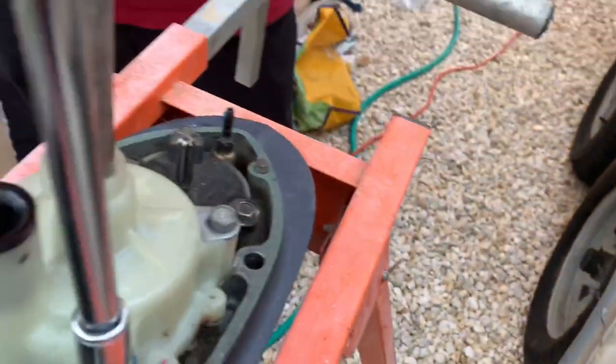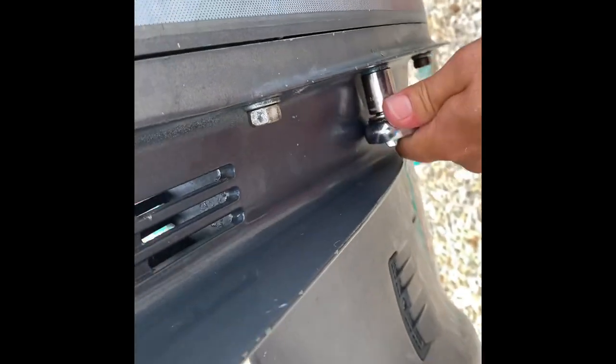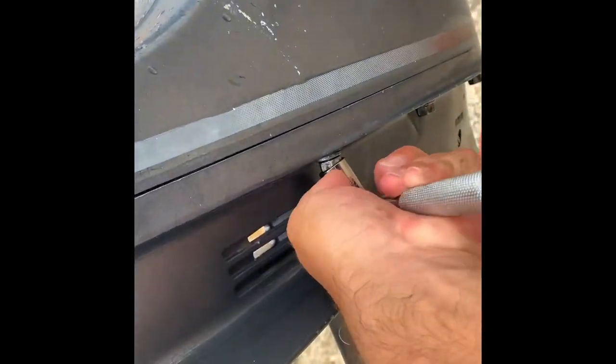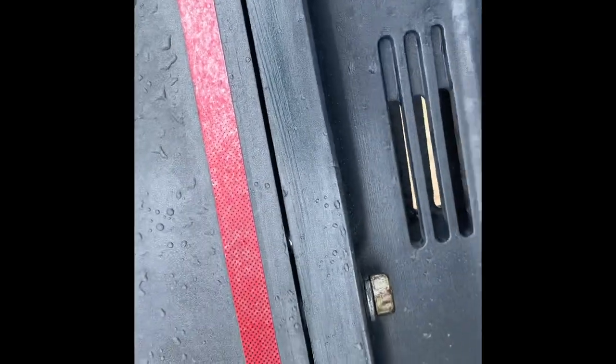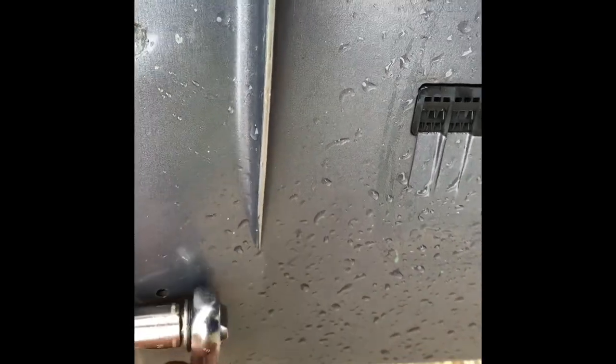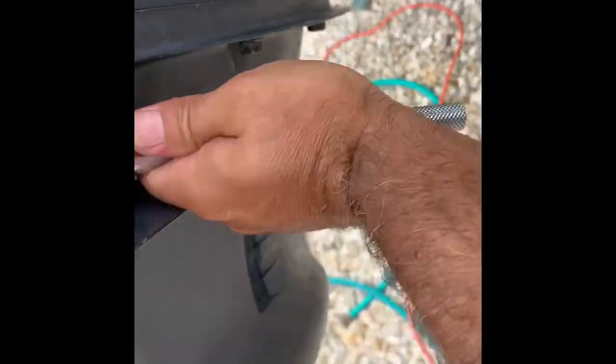I've raised the lower unit back up into the engine. There was a gap between the bottom and top halves, so I threaded in bolts one or two turns each and went around evenly for about 15 minutes to get it to seat properly. I did remember to put in the speedometer rubber hose and connect that. So far this just hasn't been that difficult — I could probably do this again in about half an hour.